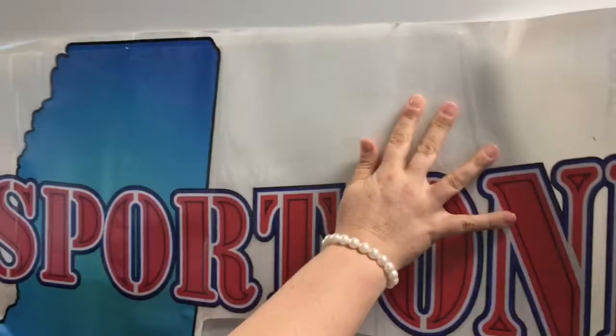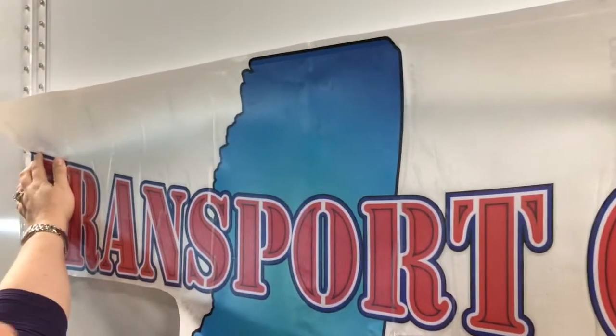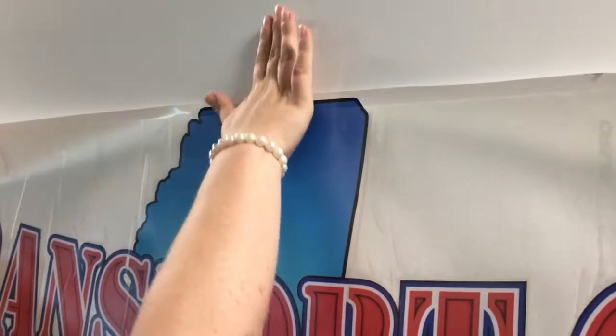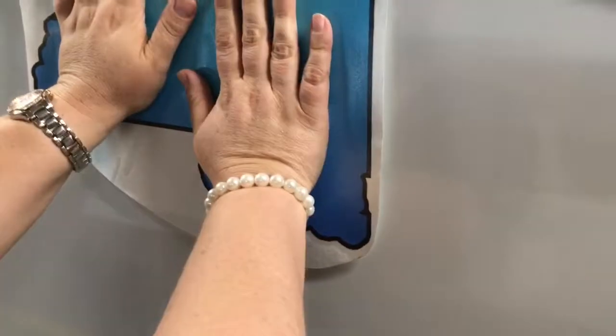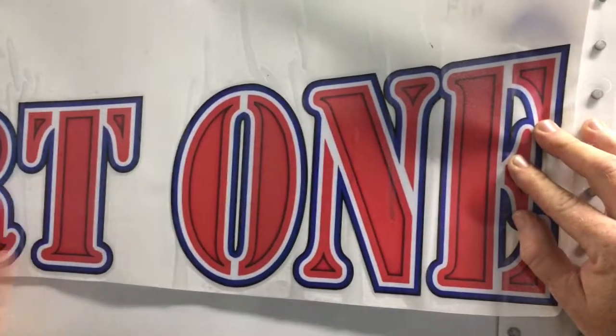She's got the surface clean — sprayed it with Windex, wiped it down well, then took a dry paper towel over everything to make sure there's no moisture. Now I'm going to place my vinyl here — you can measure it, but I'm eyeballing it using the bottom rivets I've marked. The rivet is at the top of the 'E' at one end and the top of the 'T' at the other, with approximately the same amount of room on both sides. I'm going to have Clay hold it while I tape the top and bottom, then I'll work from right to left, peel back the pre-mask, tear off the paper, and begin applying with the squeegee.